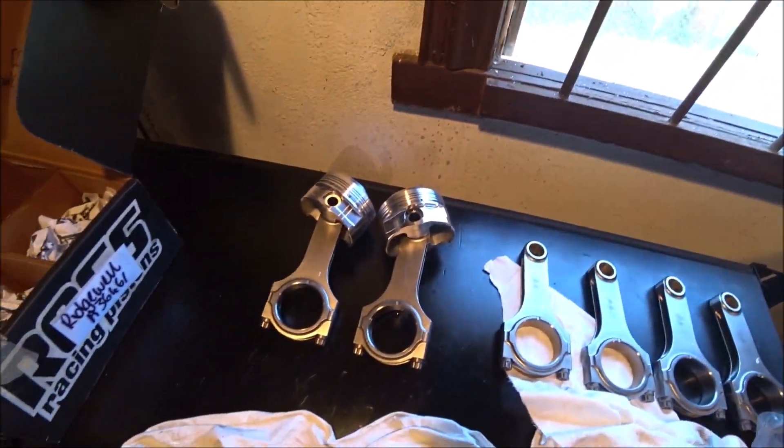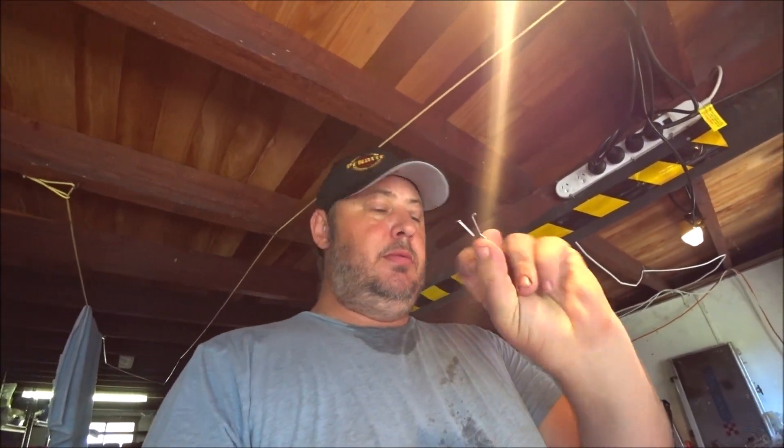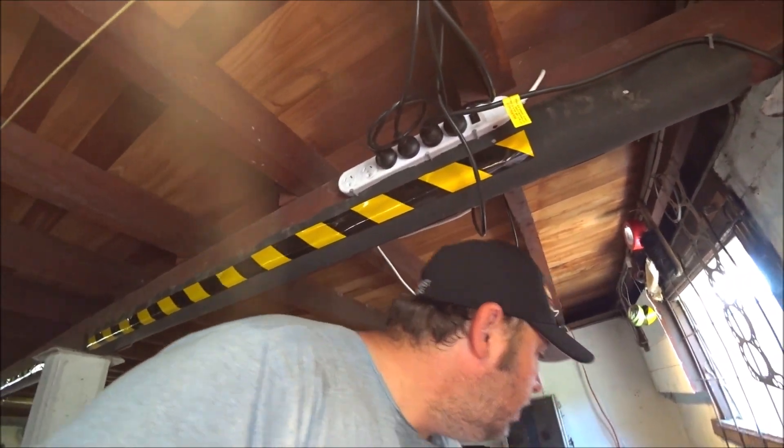Morning YouTube and the internet. Today I'm assembling the pistons - the first part of assembling the rotating assembly. I watched the video by High Performance Academy on how to put these pins in. He makes it look really easy; it's not as easy as I had hoped, but it's entirely manageable if you're just patient. He's using binder clips, which I'm also using, but mine didn't neatly fit the piston so I had to bend it a bit - but it does the job.